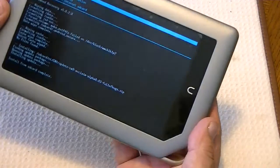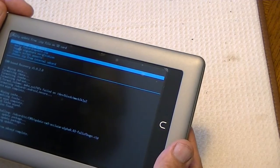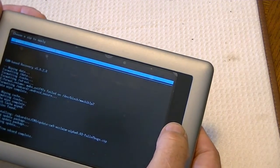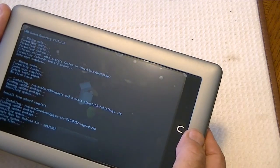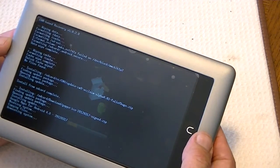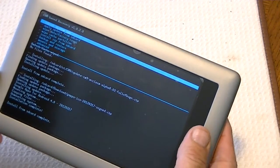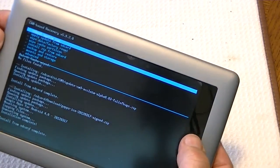Okay, so there we're through. It just didn't take very long at all. Now, we also want to choose another zip and go here to the download and get the GApps for ICS. So we install those the same way, just like a ROM. And we're through. Now we go back with the power button, and the Reboot System Now is showing. I'm going to select that. Well, before I do, I'm going to take the chip out.